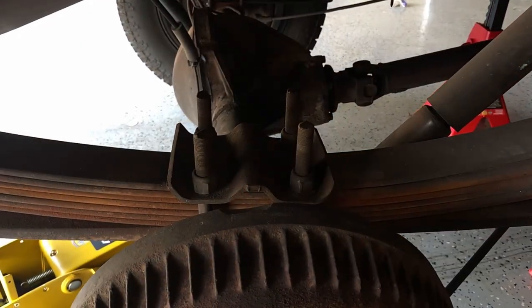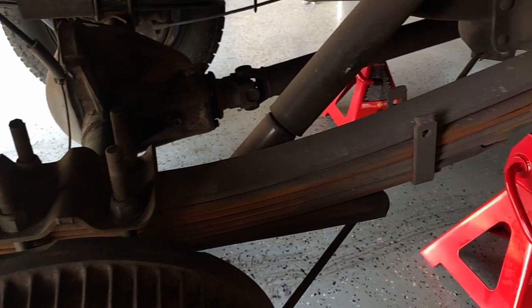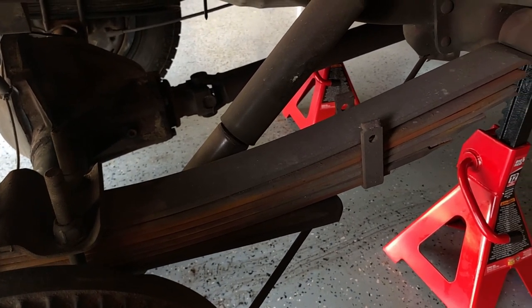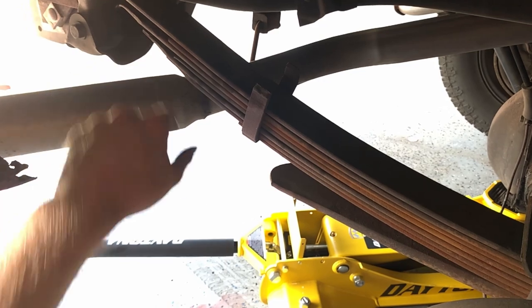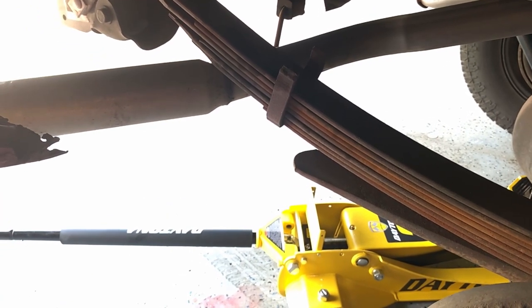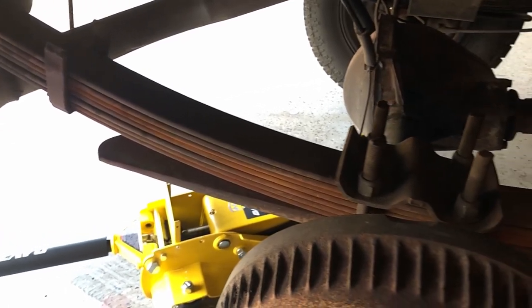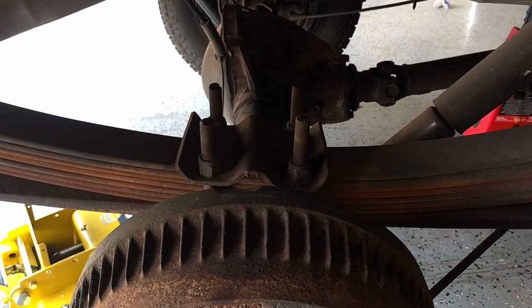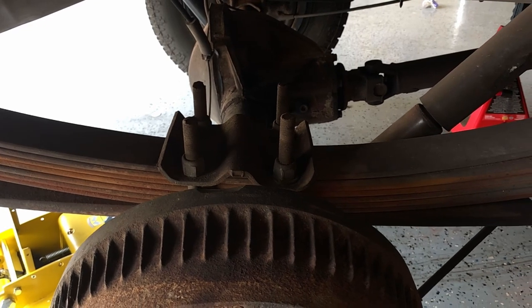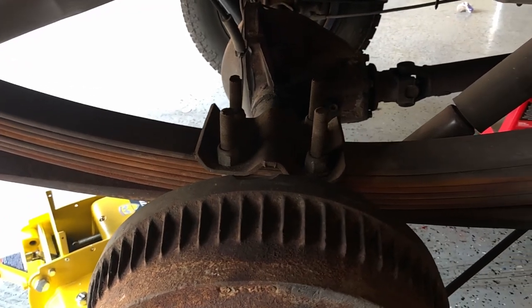The next thing you want to do is just take a look at what you got. Most of these older springs are actually quite resilient, however you can tell visually this one's in need of some help. One of the first things that typically goes is actually the bushings located at the connection points of each side of the spring itself. These bushings tend to go first — including the bushing on the shackle — because they take the brunt of the beating. You can always replace those if the spring is in good shape, but most of the time when you see springs looking like this it's time to replace them.